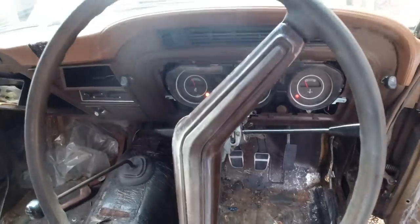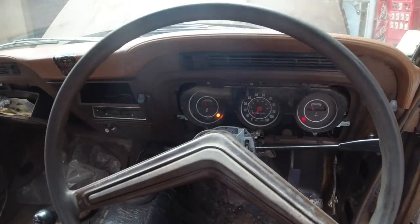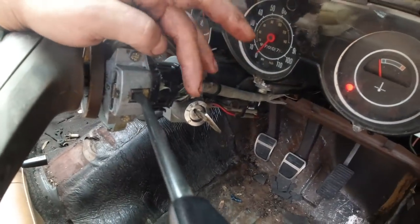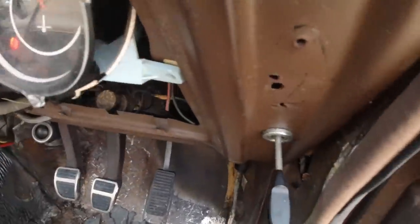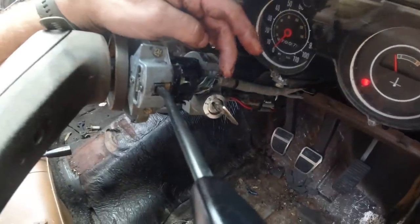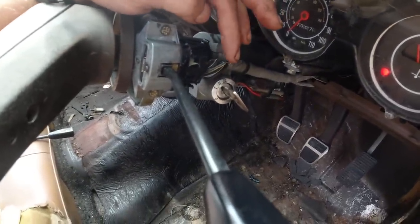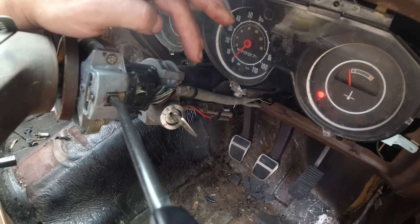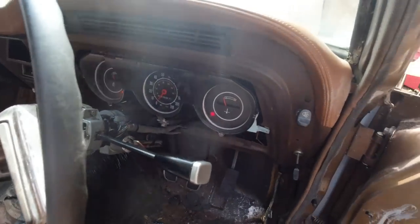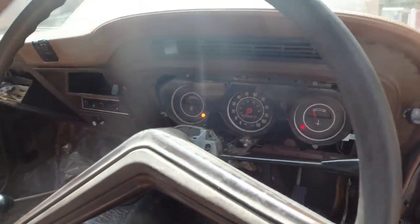Someone's very kindly cut into the wiring harness here - I think it was when we had the claxon switch down there. I need to solder here, solder there, a little link. It's not quite close enough to join together so I'll have to put a little jump link in. Then I'll test the horn in the bay and we'll see how we go.